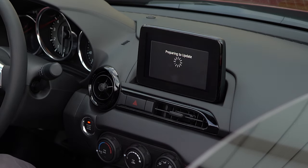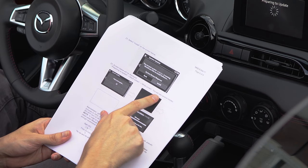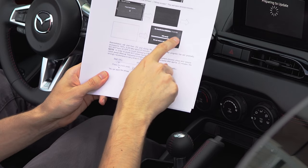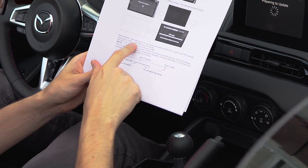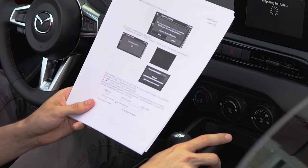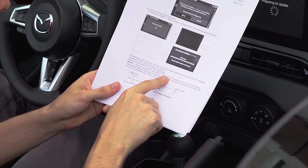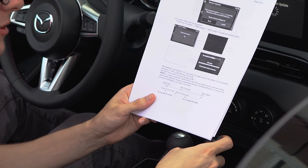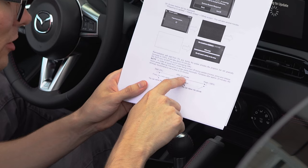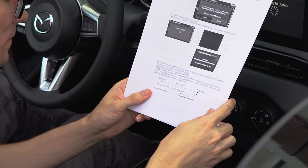I'm going to press my clutch pedal to restart the timer - set for 20 minutes. The screen below will go from black to white, which takes several minutes. The reinstallation progress bar will gradually increase to 100%. It says it will take about 40 minutes, so be pressing your clutch or brake around 25 minutes to avoid accessory power shutting off and damaging the CMU. You can leave the vehicle.